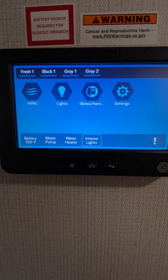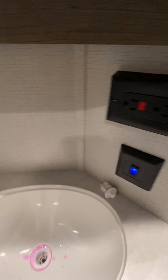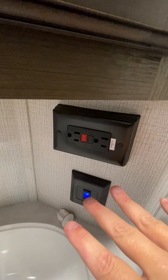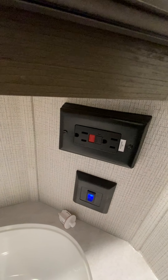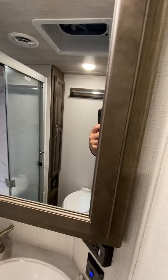So that's the in-command right there. We'll go through the rest of the camper here. You've got the bathroom right here — light switch, tub, and commode. You do have your ground fault GFI outlet. If you have some outlets that aren't working, just check to make sure it hasn't popped out, and if it has, go ahead and reset it to get those outlets to work.